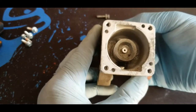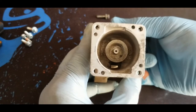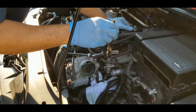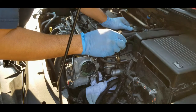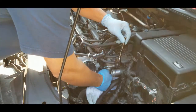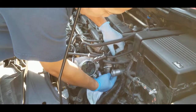It works for me. Yeah, it takes time for me to figure out how to align it. Right, so the same thing, I'm gonna position the socket like this, and then put it in between the EGR valve and the rubber hose connector, and then turn it to the left. And I still have my rug right here in case I drop the socket.